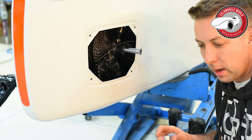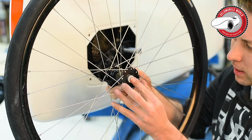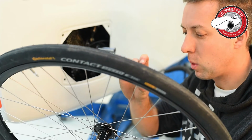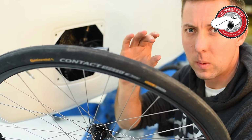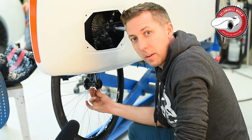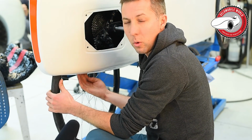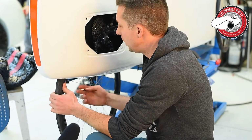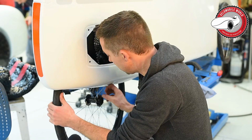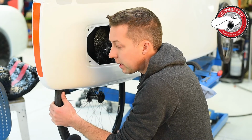So there is another tool, it will also be in the description. We will put it in here in order that the bushing between the bearings will be aligned. Between the bearings you have a bushing to keep the right distance between them. And if that's not aligned, you will never get the axle through and you will get very frustrated. It's a bit of a difficult job, but it helps very much if you cleaned the inside before you took out the wheel, because otherwise you have a very big chance that all this sand comes onto your axle and your bearings, and that's of course not great for the lifetime of all these components.